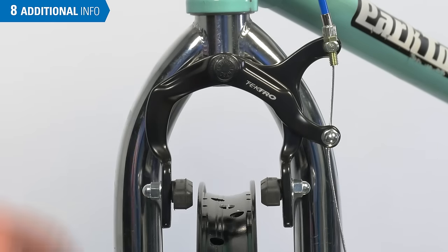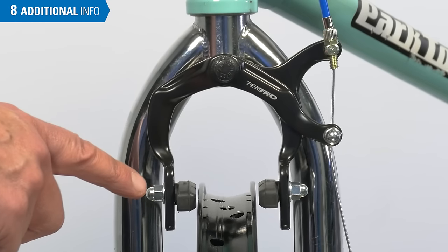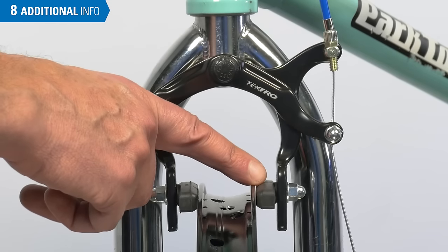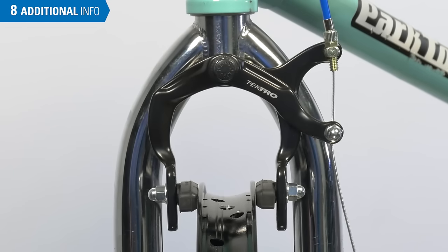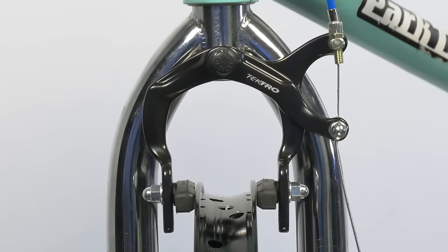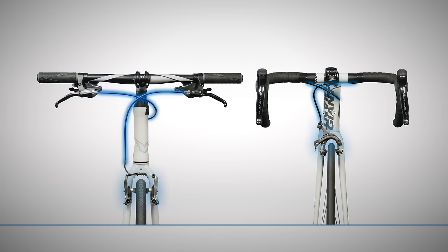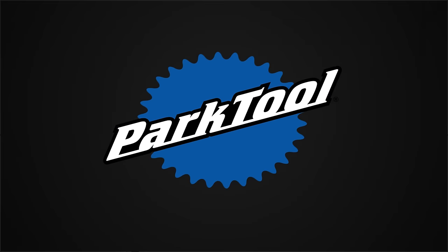On the side pull design, the pads do not shove the rim back and forth. If one pad happens to touch just before the other, it simply waits until the neighboring pad is contacting the rim — there is no movement back and forth in the rim itself. They don't need to touch at exactly the same time. That concludes the process for brake caliper mounting and adjustment. If you're looking for help on a different procedure relating to rim brakes, we've got a whole series. Thanks for watching and be sure to subscribe for the latest from Park Tool.